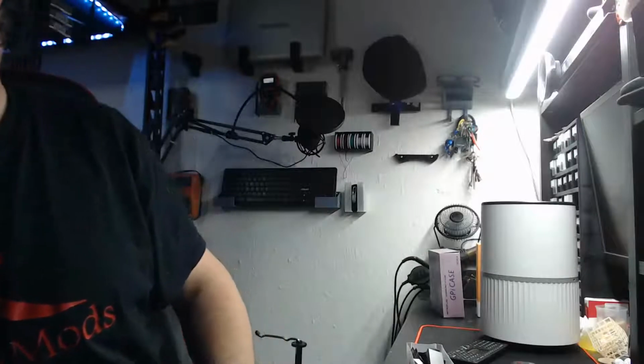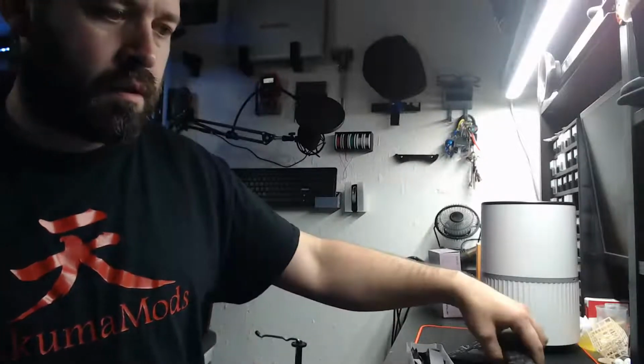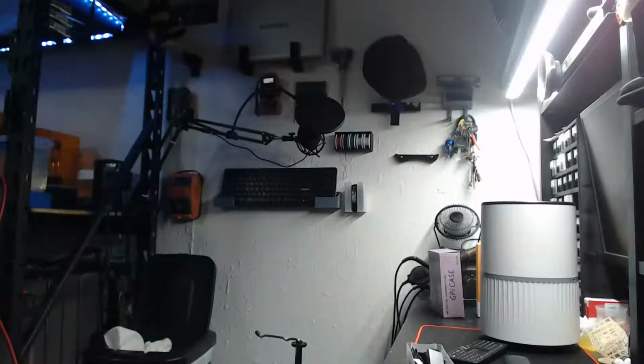What we're gonna do? Config. Line 42. This is where we're going to be testing our overclock profile. If you uncomment this by removing this hashtag, you're going to be at 800 megahertz. Do not want that. You want a higher clock. So I'm going to go to 1.57 gigahertz. I'm just going to copy all of this, and then paste it right here. File, save.